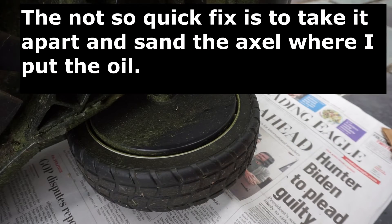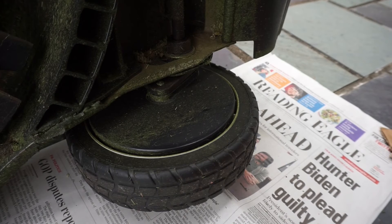If the wheels were totally frozen up, wait a half an hour or so for the penetrating oil to do its work. If they still don't free up, then you likely have another problem. I'll publish another video on how to troubleshoot self-propelled mowers that won't move forward or backwards — look for a link to it in the box below this video.